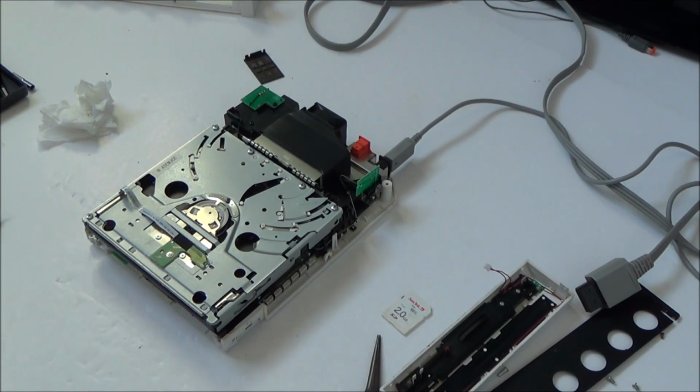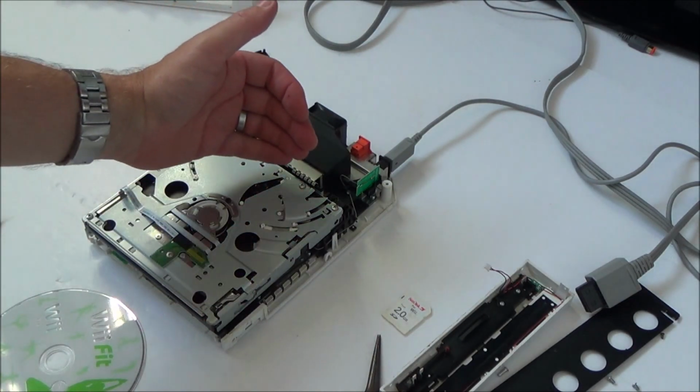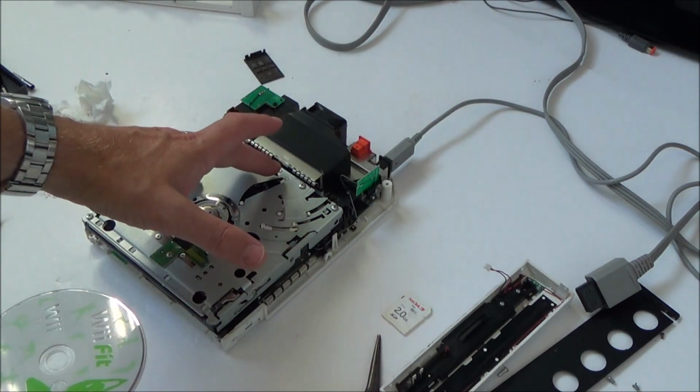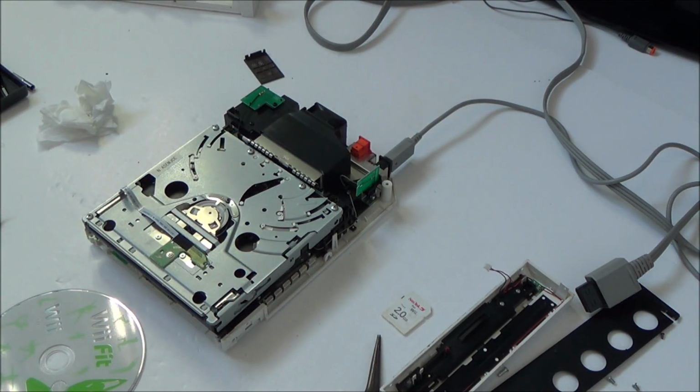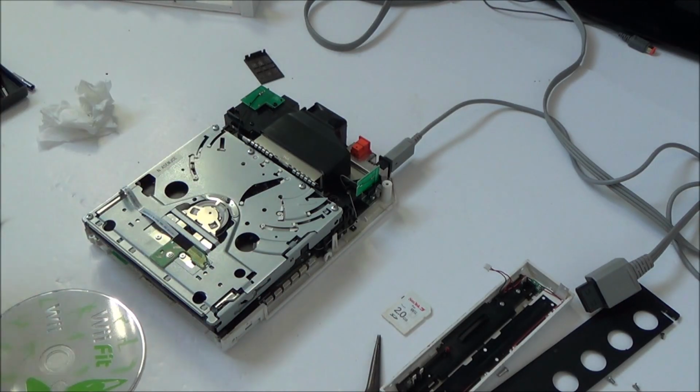Right, okay, I think I'm going to have to give up on this one. I've given it my best shot. I'm going to just play around with that gear a few more times because obviously by me doing that you can see now that it's made it a bit bigger or something and it's pushing it in towards this, acting as a brake. The strange thing is it's still not grabbing it in, so I can understand if it was to grab it in and then do that, then I would think that that bit's too big. But right now I'm still not 100% sure it is that cog that's at fault, because by twisting it you would think that if the broken bit was at the very end or the very start of the travel, you would understand that it wouldn't grab, but if it was in the middle you think that it would still work.